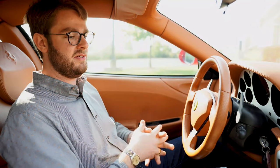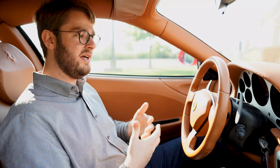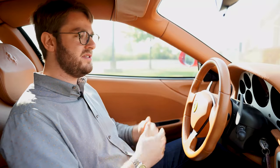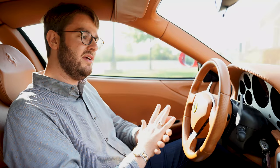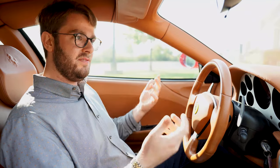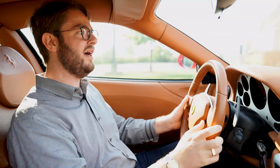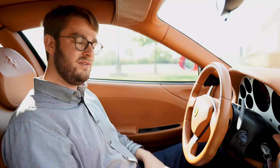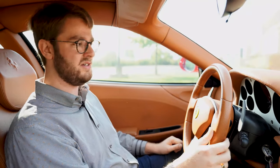So let's talk about how you actually drive this car. It's a manual transmission car underneath, so when you're at a stoplight or things like that, best to put the car just in neutral. Ferrari recommends that you do this when you pull up to a stoplight so it's not wearing the clutch while the automated hydraulics are holding the clutch in. Additionally, if you're on a hill and the car is in neutral and the e-brake isn't on, you will roll backwards — just like a manual transmission car. If you've never driven a manual before, these are just a couple of things to be aware of. If you've driven a manual before, it's second nature, really.